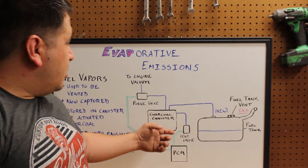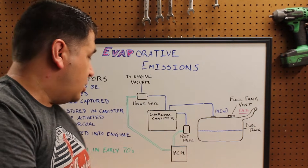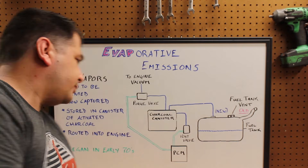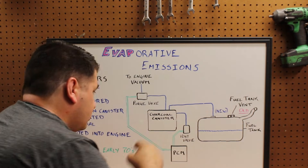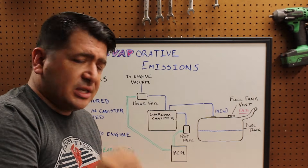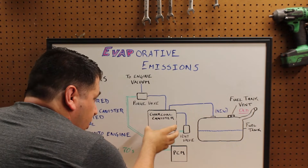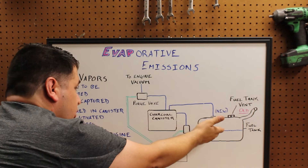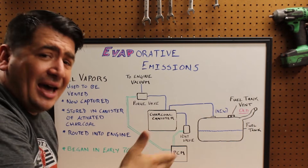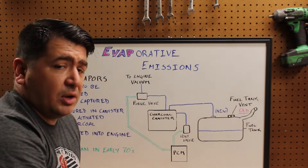Now because we rely on a flow through here into the engine, there is a filter and a vent valve that allows fresh air to flow in so that we don't get a big vacuum pulled on the charcoal canister and never be able to release it. The vent valve is also used by the computer for its self-diagnostic purposes. Not all systems work exactly the same, but they all have the same function: a charcoal canister holds the fuel vapors until the engine can support them being added, because if you added fuel at the wrong time — like at idle or right when it started up — it might kill the engine by running too rich.